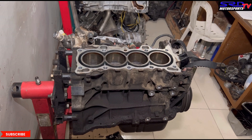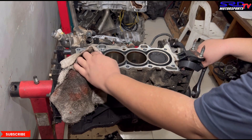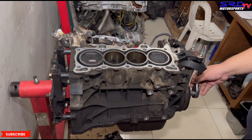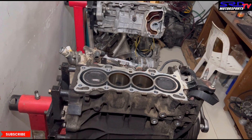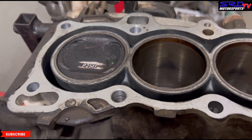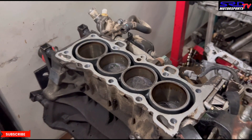Let's look closer to see how the bores are. Let me turn the pistons — let me wipe this to show you the piston code. I keep forgetting the local VTI codes because I know everything about the ESI, the D16A6, and of course PM7 and P29. Let's check it — P2M stock VTI pistons. Would you look at that — you can still see the crosshatch! This is a 97,000 kilometer engine. Props to Honda — that's crazy.